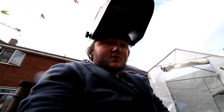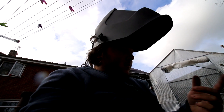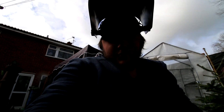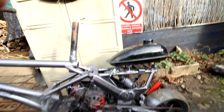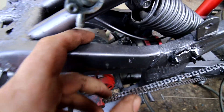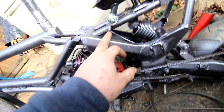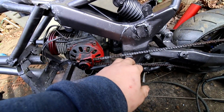A little while later we've had the fuel tank mount done. Fuel tank is on. Let me show you - it's not pretty, but it doesn't have to be pretty because it all cost me nothing. It was all in the scrap pile. We have the fuel tank mounted on the back. We just welded the studs to the frame. We have the fuel tap here so we can turn it on and off. The fuel line will go from the tap, run inside the frame, down to the carburetor. The reason I did it like that is because the chain is on the outside - didn't really want to run the fuel line on the outside of the frame, so we run it on the inside. That way there's no chance of it catching the chain and snapping.